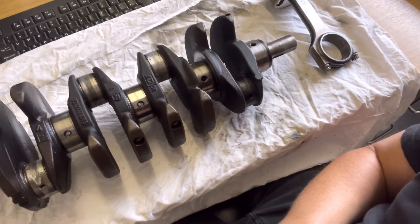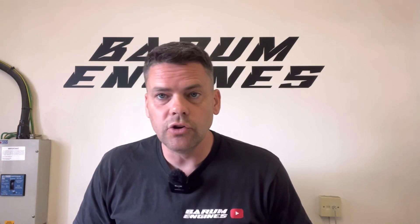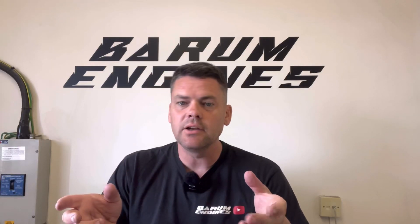On this one, as you can see, all the big ends have gone — they've all seized up — and all the mains are okay. The piston and rod obviously, it's done all the ends. This thing basically seized up after a short period of time and we had to strip the engine just to identify what we thought had gone wrong. How do we choose the correct clearance on a big end? That's with plastigauge and measuring. I'm not going to go into too much depth with this because I've showed you sizing rods and what we do there.